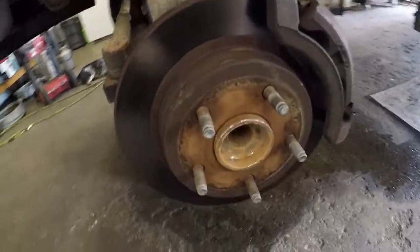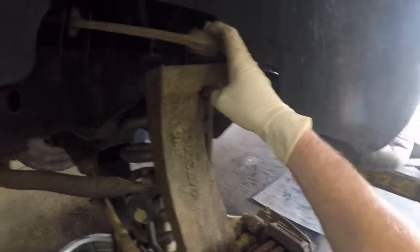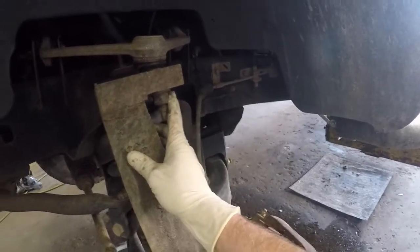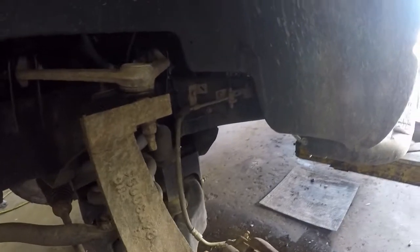As you can see, this thing is in fact two-wheel drive. It's got a big old lift on it — probably about six inches worth of lift. We're going to go ahead and take the upper control arm out. We've got a couple of bolts back here and then our single nut that holds the ball joint onto this portion here, which is the spindle.